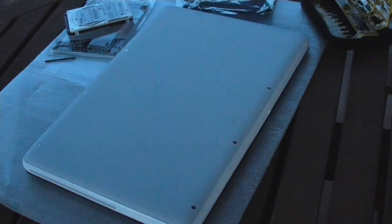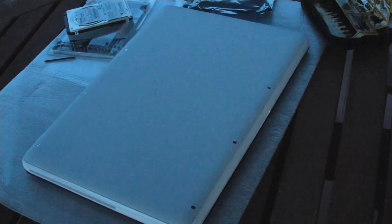So you just learned how to install eight gigabyte memory in your MacBook 2010 White, and a high-performance Western Digital 500 Gigabyte Black Series Scorpio Hard Drive. Even if Apple doesn't offer an eight gigabyte upgrade for a white MacBook 2010, it's possible, it's supported, and it works like a champ. This is my second machine and I tested the first — it works perfectly. The motherboard recognized the eight gigabyte as eight gigabyte. The hard drive is better than what Apple installs. The memory has a lifetime warranty, and the Western Digital Black Series 500 Gigabyte Scorpio has a five-year warranty. It's 16 megabyte cache, 7200 RPM — very quick — and uses the same energy as Apple's 250 gigabyte 5400 RPM, stated even a little bit less by Western Digital.